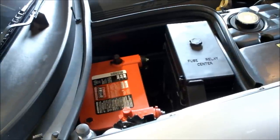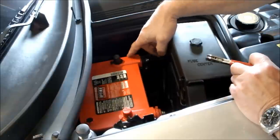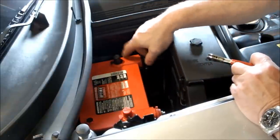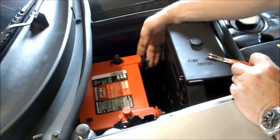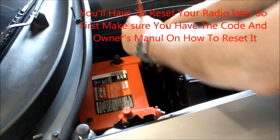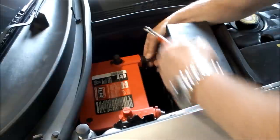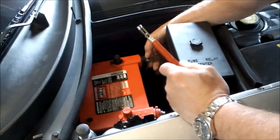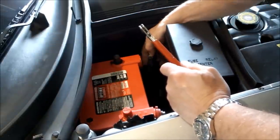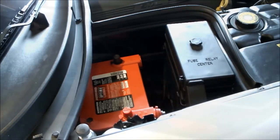Take your 5/16ths and disconnect the negative lead of the battery — that's this one, the one with the negative sign. The negative terminal is closest to the engine and the side terminal is what you disconnect. Always facing the bolt: left to loosen, right to tighten. Just loosen it up. You're going to hear some crackling noises maybe and a little spark, but don't worry about it. Just push it off safely to the side and make sure it can't come back.